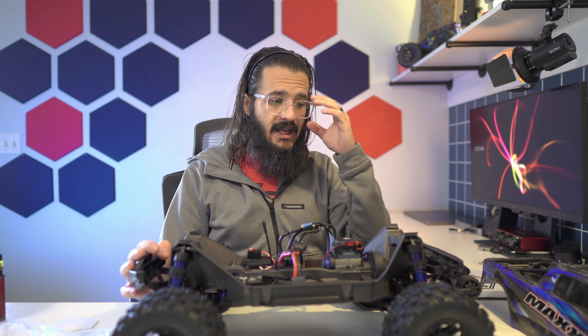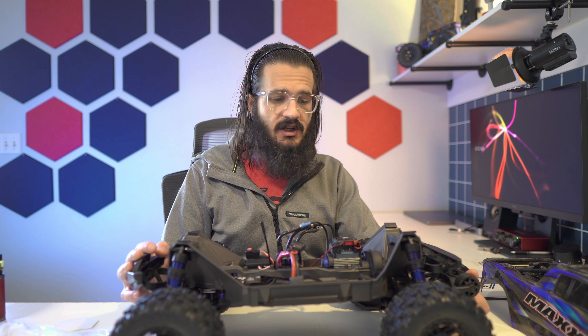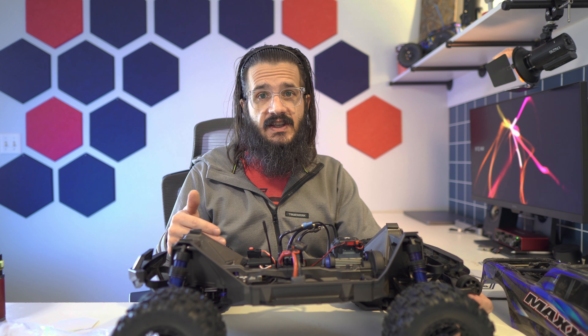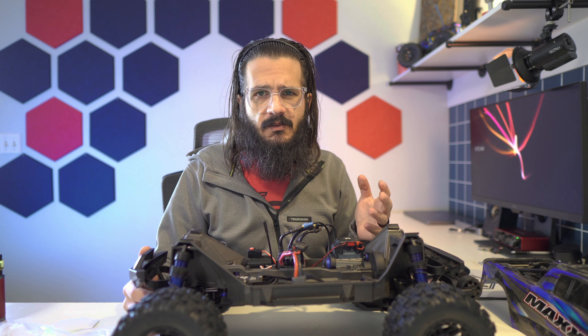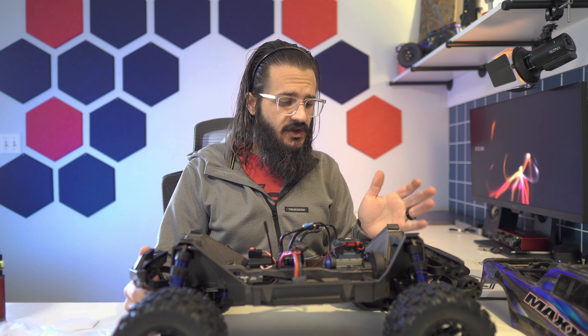Things that I have done and the reasons why: I don't like the stock suspension out of the box. So I changed to 1100 CST shock oil and I put the VG Racing springs on it. I also put the M2C Racing pistons in there because I like the way that they feel — I change pistons to M2C Racing, I think they have a really good piston system. I put the same shock oil all the way around and I'm probably going to keep playing with that a little bit. I tend to really like VG Racing springs, so if they have springs for a vehicle I have, I'm going to put their springs on.